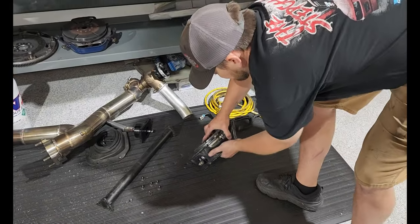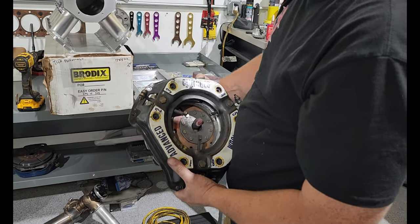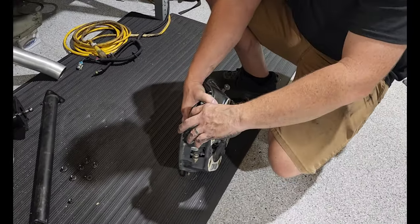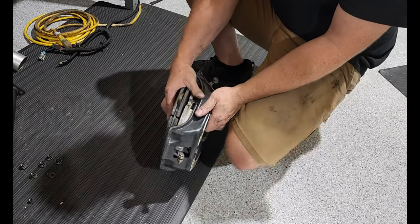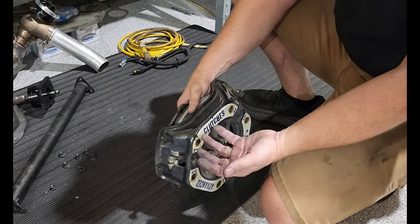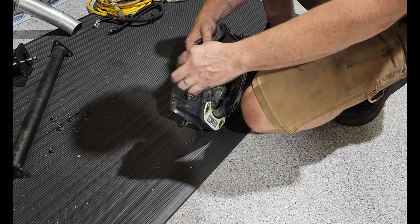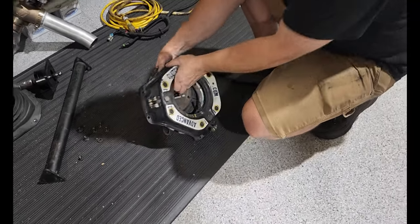it's basically a three-lever design. And of course, this is stamped steel instead of billet. And another thing that you have to maintain as everything wears down is the height of the ring inside of here. Basically the height of the pressure plate, because when the discs get thinner, you see the discs in the floater here, as they wear down, then you lose base load. So eventually, in the design of this one, you would just take shim out from behind this stud, which would go between this and the flywheel. So as things wear, you're just gonna keep reducing that shim to mount.